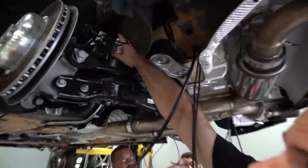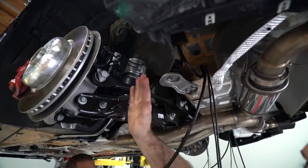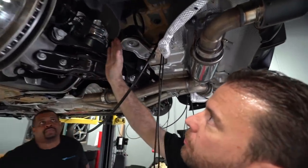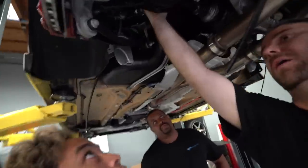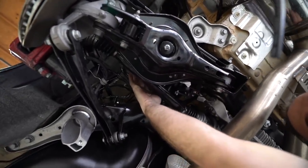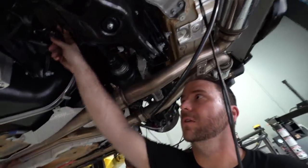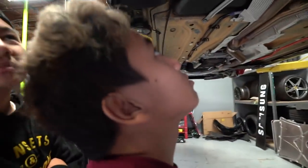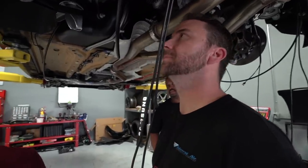For the height sensors, the options are going to the back or inside of this subframe - the key idea is to keep away from the wheel. We need to look at what's the furthest thing sticking out and the shock absorber is further out, so as long as we're tucked in more from that we're good. We can either come down to this arm or eyeball over here on the front side to the upper arm - it's a really large flat arm we can easily drill into and do a little standoff. We just have to see how much travel we're getting at those points. For the front, we did the mount from the strut body straight down to this lower arm - as long as it moves with the arms, it's fine.